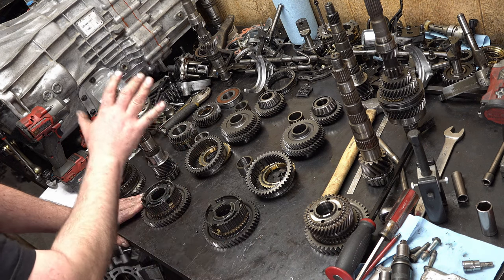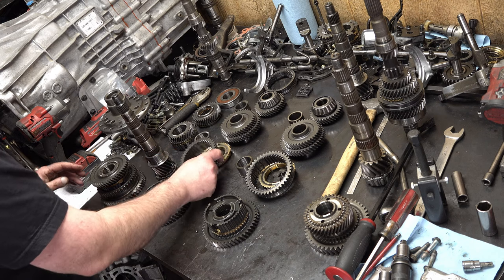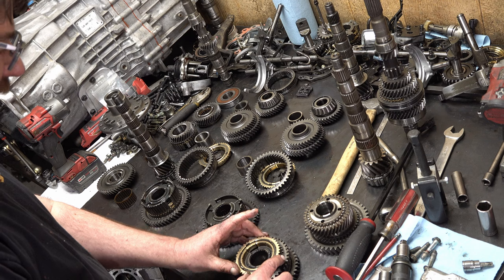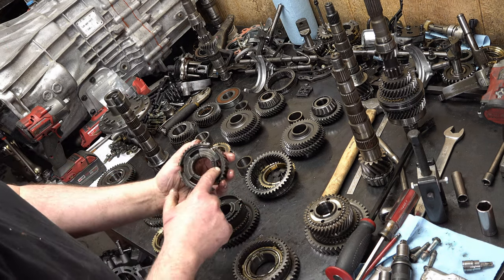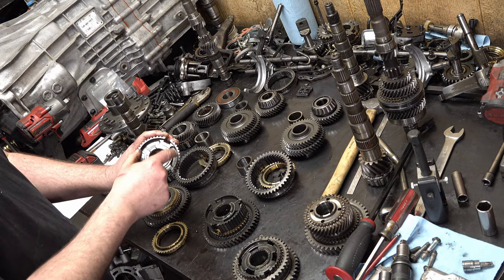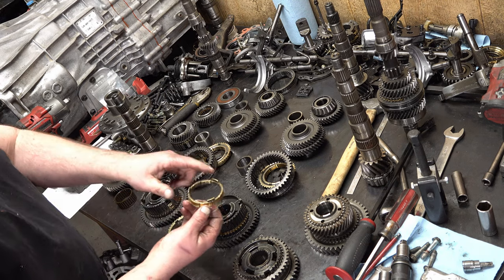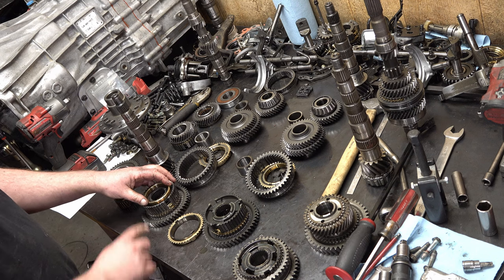I was originally planning on doing this with an E350 but I had that E56 just sitting around and it wasn't even a complete transmission, so I figured I'd make the best of it. But the synchro assembly on the E350 for first and second is actually better. I'm going to use it — it's honestly a little hard to describe how it's better, but the big takeaway is in this ring here you can see this part was made with the intention of triple synchronizers. When they made this one they machined this part out, and if you look at older ones it won't have these pockets in here — this was more of an afterthought.